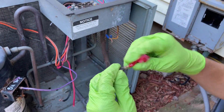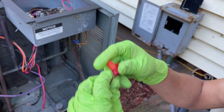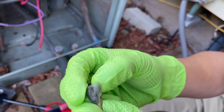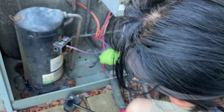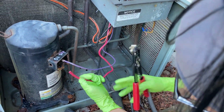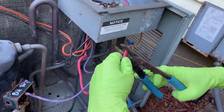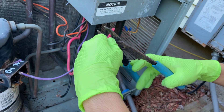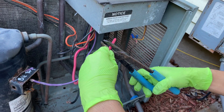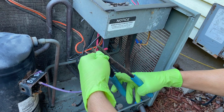This is what the connection looked like before — you can see my dad's attempt to insulate it and protect it from shorting, but clearly that didn't work out because what ended up burning was the connection side. Anyway, let's try stripping this wire. This one's a bit thicker. Let's give it a bit of room so that we can turn it around and twist it on itself.